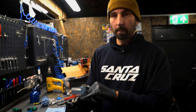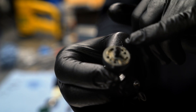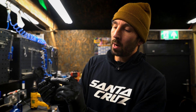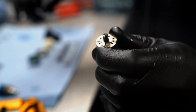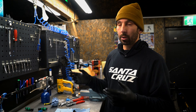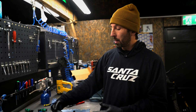I can show you the piston architecture now. You can see all these complex flow paths and holes. These round ones here are all compression flow — so that's when you sit on the bike or you get a bump, the fluid flows through these holes creating resistance, then whacks into these shims and pushes the shims out of the way, and that's how we tune the resistance. On the rebound stroke it goes through these other little holes, pushing the rebound shims out of the way. We can measure the diameter and thickness of these shims and compare them to Ohlins tune sheets — Ohlins spec for us based on rider weight or bike leverage which combination of shims to use.